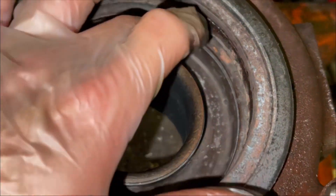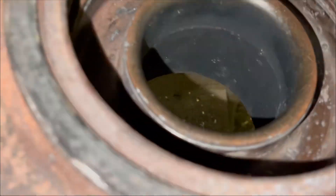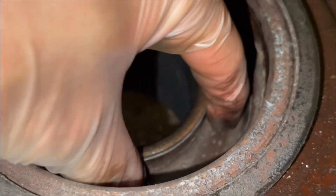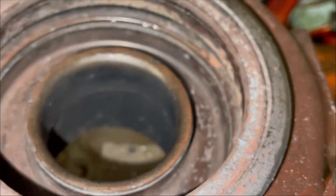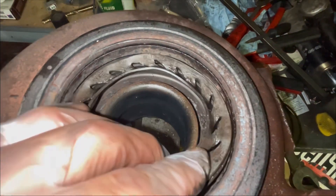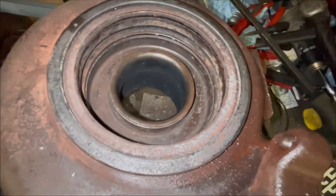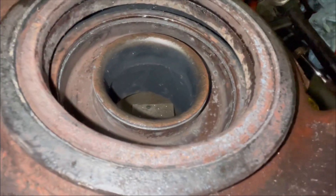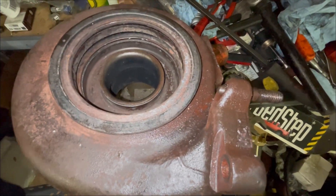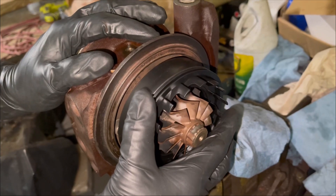You can see there's an upper lip, then the snap ring groove, then the lower lip — so the VGT plate rides essentially on this middle lip right here. There's a step right there. This housing is harder metal than the plate. What we did was fold the plate on itself down to expose the ring, pop the ring out, then shimmy it back up. Whether by luck or skill, we got it out with no damage to the inside area where anything rides. We're going to soak this in some cleaner and get it fresh and ready for new parts.